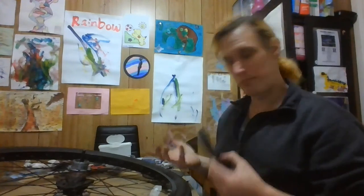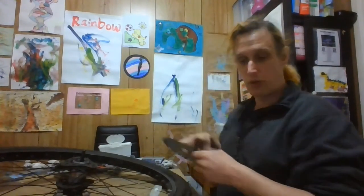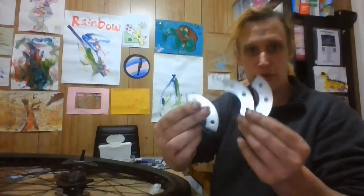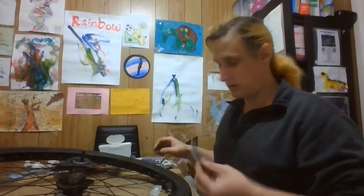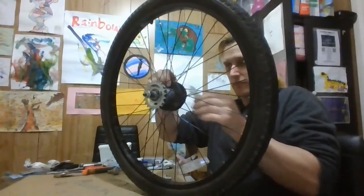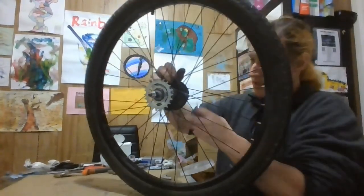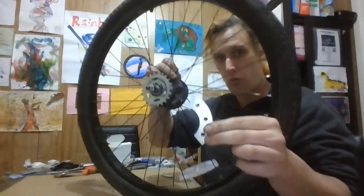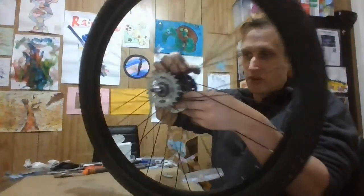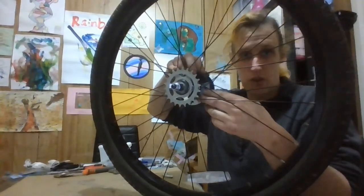But I've already fitted it up sort of once today. It does work. So make sure you've got your 2 rag joints on. We obviously need our sprocket, our 1, 2 and 3 crescent shaped packers, I guess, which will sit on the inside there. Alright, so 3 of those. Good piece of advice is make sure that one of these is overlapping the cut that you've made. You don't want the edge of the crescent to be sitting on the edge, otherwise it's just going to flop around. Added support, make sure there's an overlap.